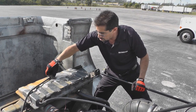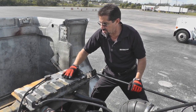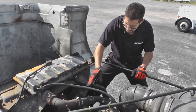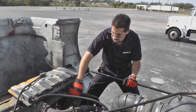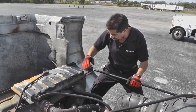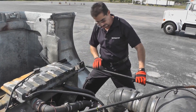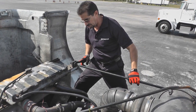We're going to turn our cap back. We want to make sure when we check our cooling system the cap is not missing. We're going to check our water hoses, making sure they're not cracked, no bulges or frays, and they're not leaking. We're going to check our radiator bracket, making sure it's secured, and that the bushings are in good condition.